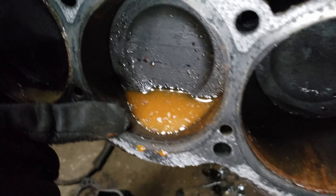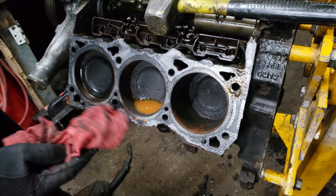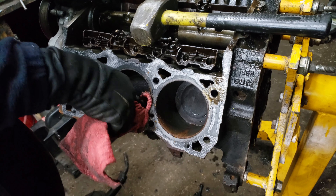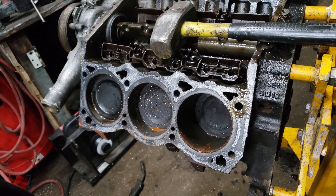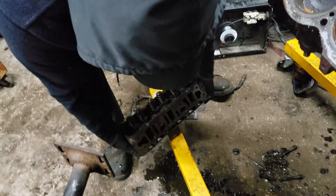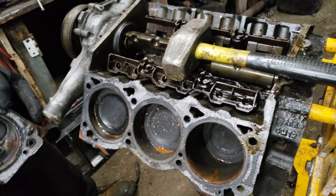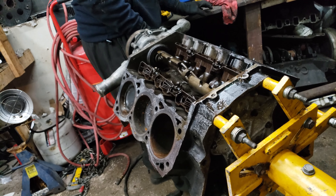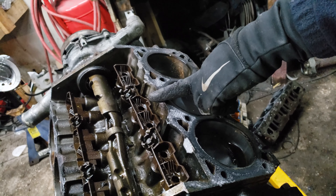All my pistons are somehow good. Let me get a rag — I don't think I've ever taken a 3800 apart that had all six pistons intact. Usually if the pistons are good, it's good. Pistons are good — interesting. Let's see if I blew a valve or something. They all look good to me, kind of crusty but it had water in the cylinders. I want to say bearing — that was my guess too. Or maybe a slightly bent rod. You think this rod might be bent? Yeah, maybe a little bit — just a bit though.